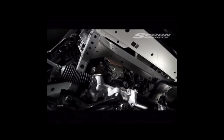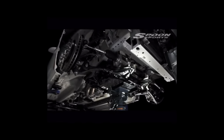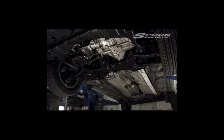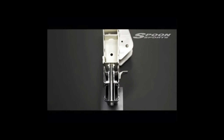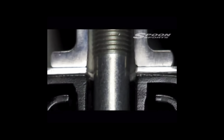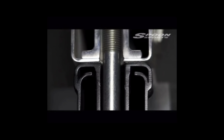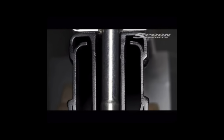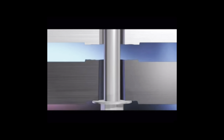In all modern production cars, the engine, transmission, suspension and body shell are all mounted to the subframe. Bolting the subframe and body shell together makes for an incredibly stiff construction, but problems arise between the mating of the two structures. You can see in this cup model that the bolt is far too small for the hole in which it is supposed to fit, with significant room either side of the bolt. The holes are made so big to speed up the production process when the car is being built at the factory.